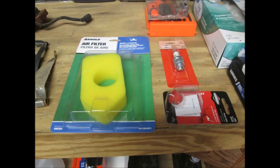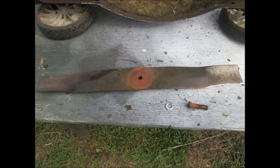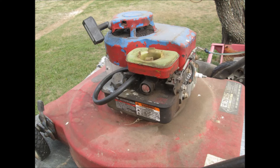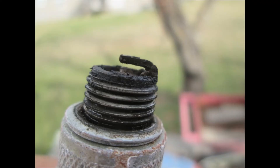We've got a change of plans — we're going to refurbish and service the Heinz 57 mower. I'm not sure what the horsepower is, but I pulled the blade off, got a good edge on the blade, replaced the lock washer, overall checked the blade out. Everything looks good. Cleaned out from under the mower deck while it was upside down, getting all the fuel and oil out of it, added new oil. Took the parts that I'd bought for the $10 engine — it has the same carburetor setup — so I've got parts now for this thing, replaced those. Pulled the plug, looked at it, it was pretty grungy, so we put a new plug in it. Let's see how this thing's going to run.